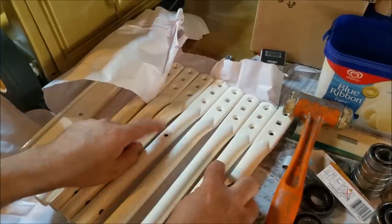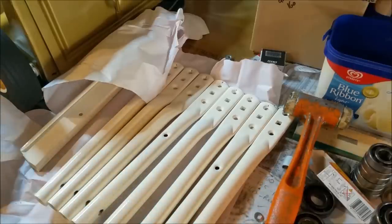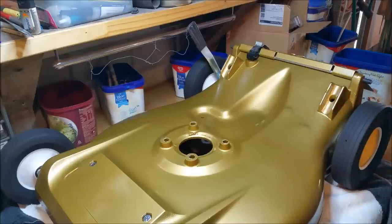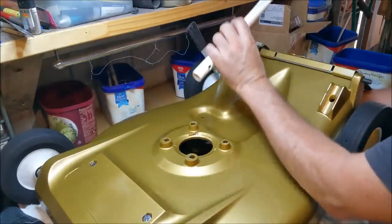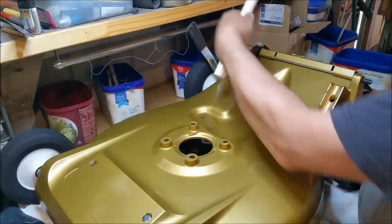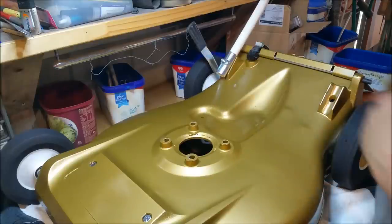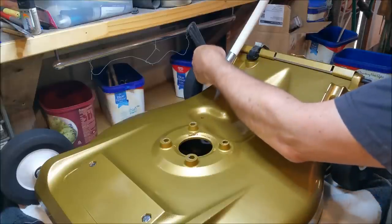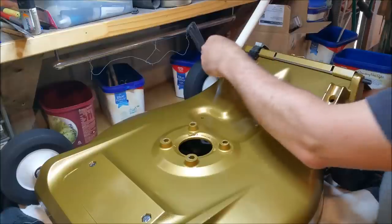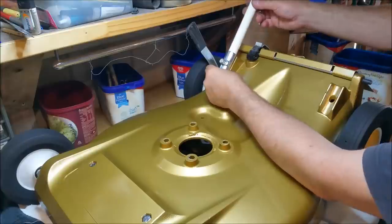That's a standalone piece for the other one. Those two are different — that had a bar going between them, a little rod, so I'll leave those out as well. Here we go — we'll pack the bolts through. These are square-headed bolts — the flat face faces the outside. So I think that goes like that, then that, then a flat washer, then a nylock, and we just tighten them up. That will look rather nice.